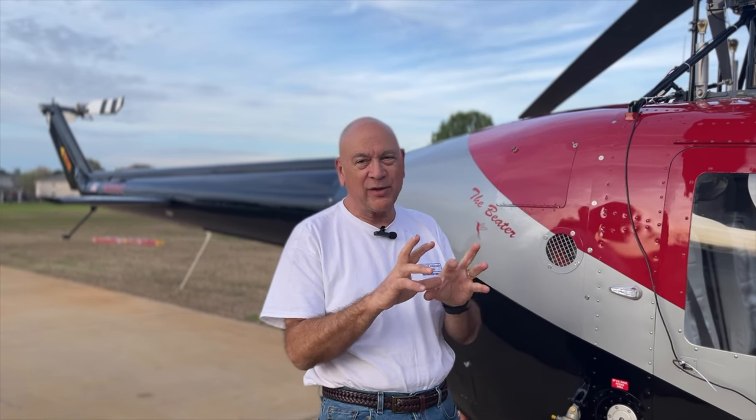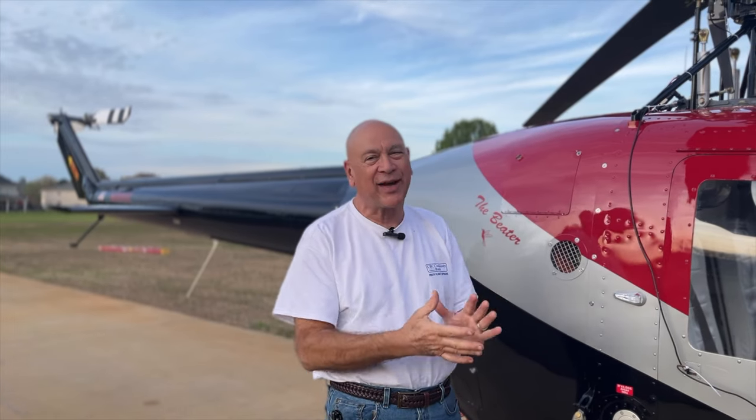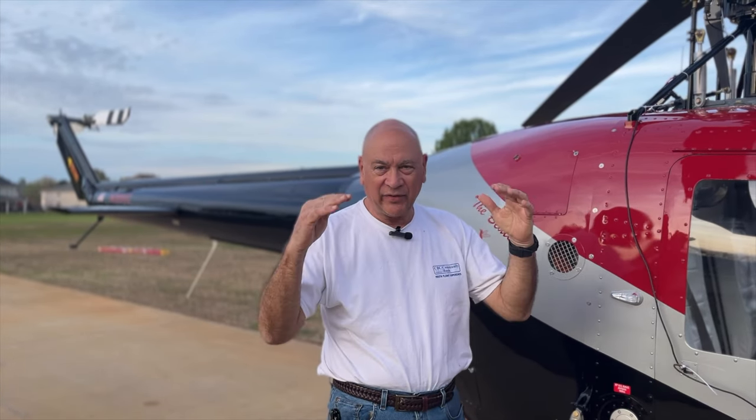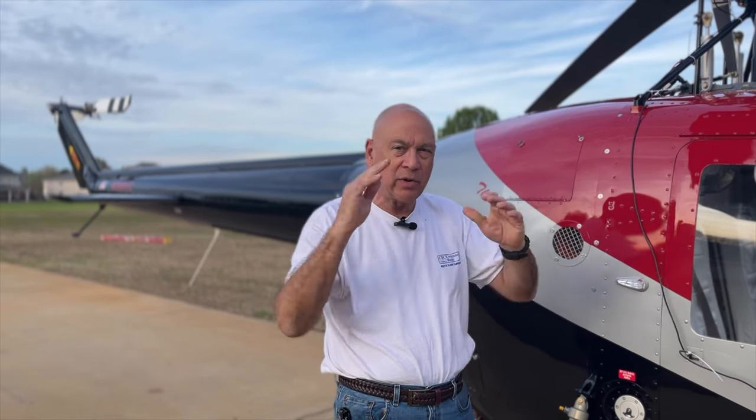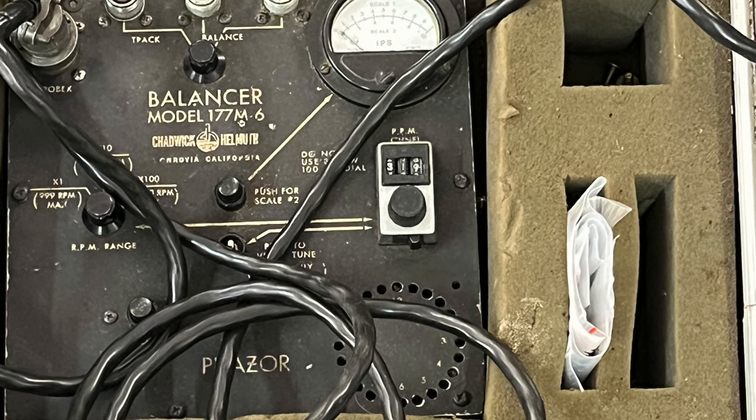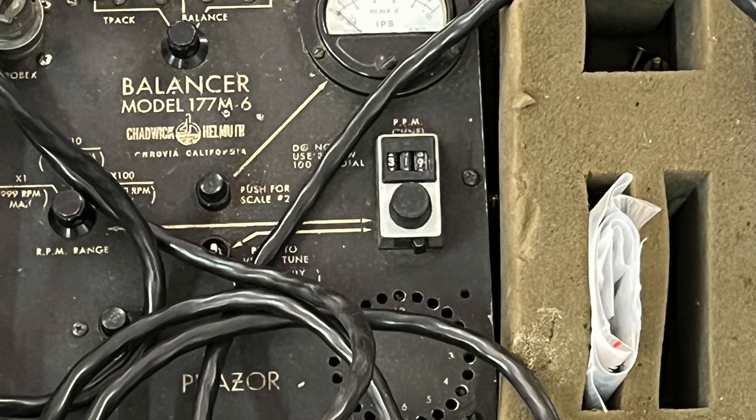Hi everyone. So I know lots of feedback from the last videos. Everybody's saying, boy, the blade tracking, what's that vibration, et cetera. But that's what, you know, we just got this helicopter finished, and that's a lot of the testing. So initially, blade tracking was just set up on the ground using levels, measure, etc. Today, managed to get a Chadwick on there, courtesy of the factory. So that was pretty exciting and made a huge difference.